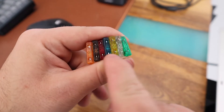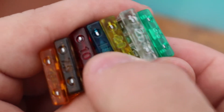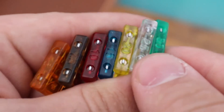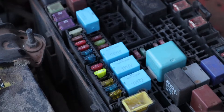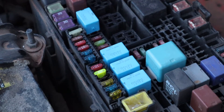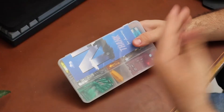There are fuses that aren't as obvious, so here are some important things to know. Always replace the fuse with the proper amperage. Over the fuse there's a number — this refers to the amps it's rated for before burning out. If you replace it with a lower number, the fuse will burn too early. If you replace it with a higher number, the fuse burns too late and you could damage your components.